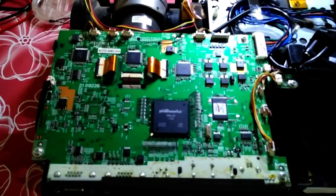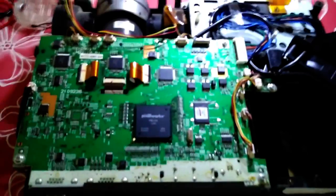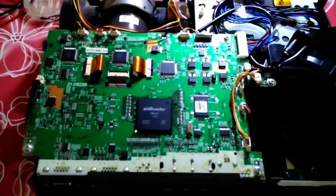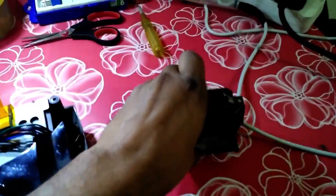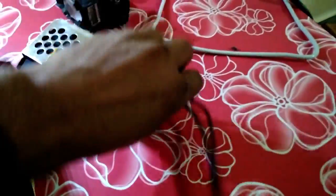We need to find which two wires from the control cable send the lamp-okay indication. We have to short those out to fool the projector so that it will still turn on after removing the light. You can see that I already removed the lights — the power supply appears to have blasted — and now we'll figure out how to short the two wires.